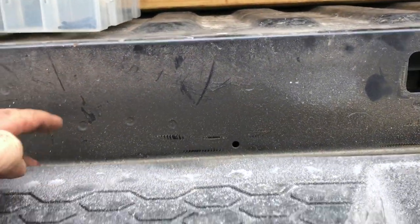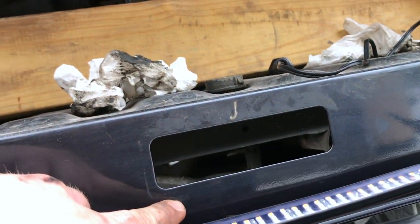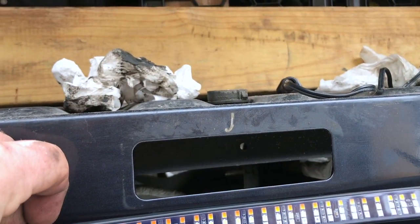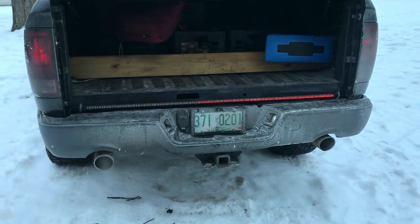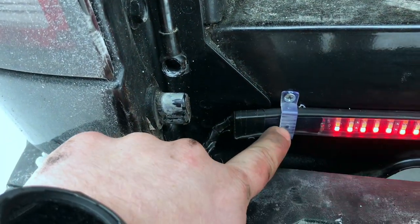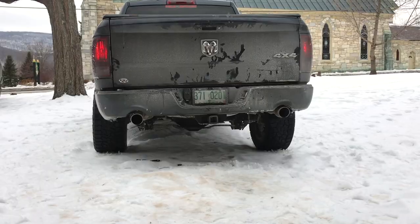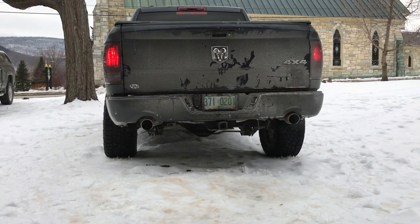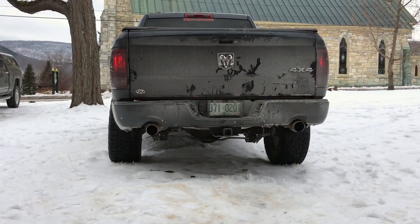We're going to clean up all this grime — use a degreaser or something — then stick it on with some heat and throw the tailgate back on. Got it all cleaned up, so now we're figuring out where to stick this — probably right below the outline of where the trim piece goes, measuring down from the top of the bed. It's all on there — it also comes with little brackets to help hold the ends on, using a small metal tapping screw. The torch works really well to stick it, the 3M tape peels off and sticks very nicely. Excuse the weird blinking — that's just the camera frame rate. It looks really good in person and I'm pretty impressed with them.